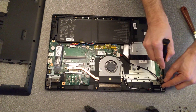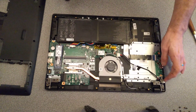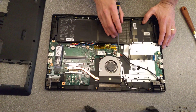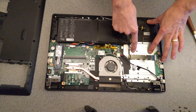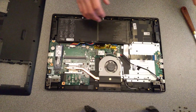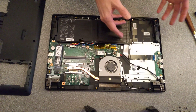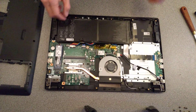The power jack is fairly easily replaceable — it's a module rather than being soldered onto the board, so if you damage your power jack that's going to be particularly easy to replace. You need to unscrew that bracket and move the hinge up, as part of the hinge is keeping the power jack in place. That connector there could potentially be for SATA to the traditional hard disk, which would have gone there if the machine had one. A common question is: I've got an SSD but I want a hard disk for extra capacity — can I do that? On this machine you can't, unless you can find the lead that goes from the motherboard to the standard Serial ATA connector.